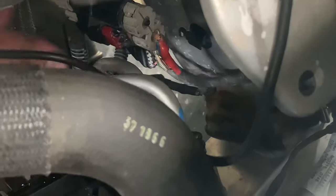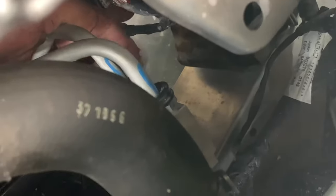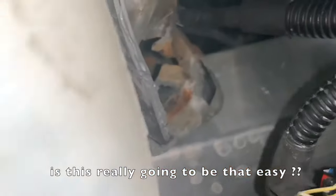I'm going to check out that ground right here, because this is the part that was hit. I just want to verify that it's not loose or anything, because especially when you work on cars that have been damaged, that's one of the things that shops forget to do. Let's see — oh my god, this sucker is loose! Let's go to the bottom side and look at it a little better. This is just way too loose.